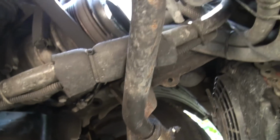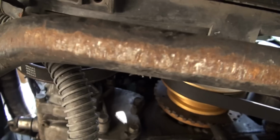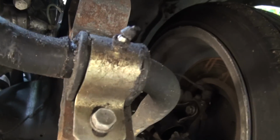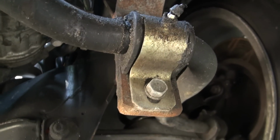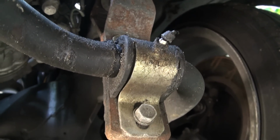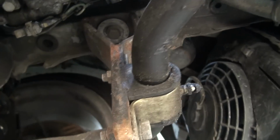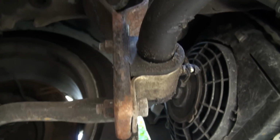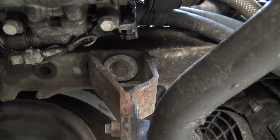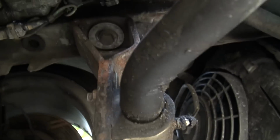Okay, so now underneath here, here's a 28mm front sway bar. Looks like he scraped the ground a few times on this, so he's been driving kind of quickly. And then here's the sway bar bushing. This is a special bushing that he's made with a greasable fitting in here, so you can lubricate that. And then the mount here that he's made is very one-off, very strong, custom-made front sway bar mount right here for the left side of the car and the right side of the car.